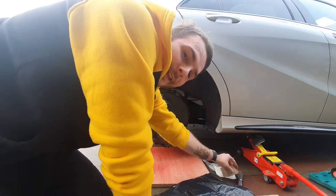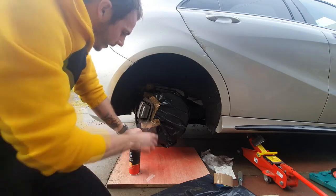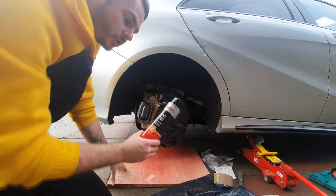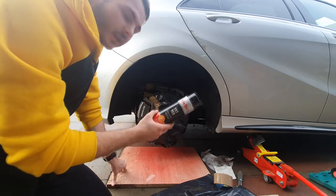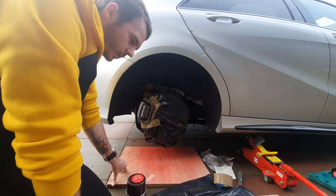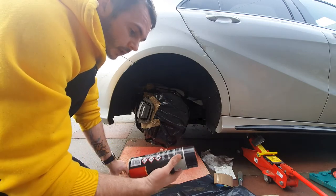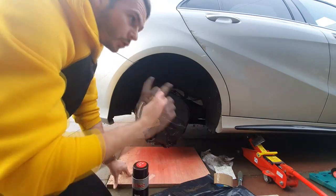It wouldn't be an Andrews build without using masking tape. Next up is painting. We've wiped it all off and masked off what we need. I've chosen this VHT Red - Very High Temperature red. It went on really well the first time. It's not sponsored or anything but I would recommend it - it goes on really easily. If you're a beginner, it's probably easier to work with than the Halfords stuff in my opinion. I'll start hitting it with the coats using the hairdryer to speed up the process - I was giving it five minutes of the dryer then back onto paint, and they've turned out fantastic.